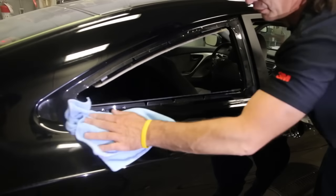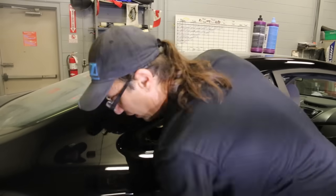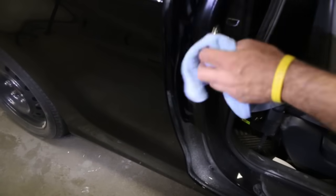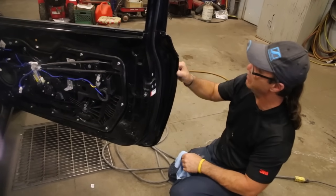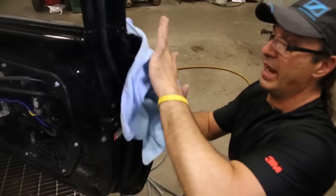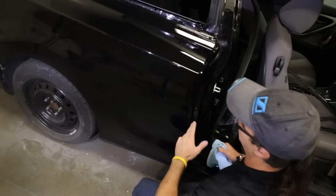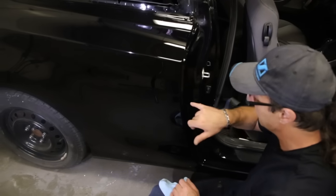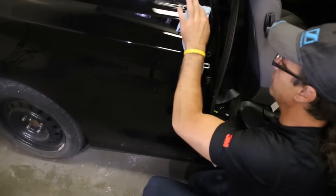With that final blue glaze, it's really nice because it's a little bit oily and kind of wet, so any compound or polish you may have in any of the cracks tends to loosen it up a little bit. You can see all the dirt from my compound — if I was to wipe that off and then do the outside, all that grittiness is going to scratch your surface. These panels do have just a tad bit of a clear edge — kind of normal when you're painting something with foam tape. So take your rag and rub really hard on the edge and it actually makes it come off really nice.